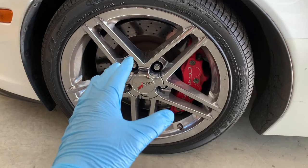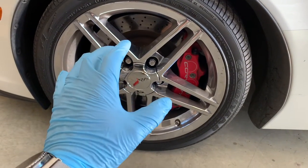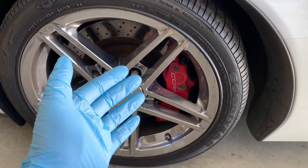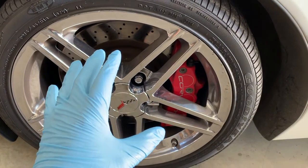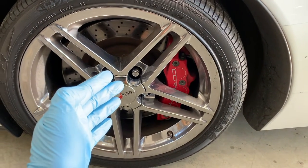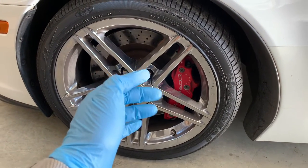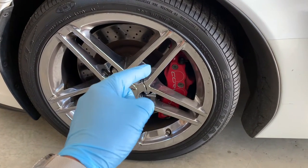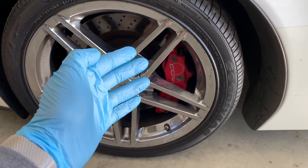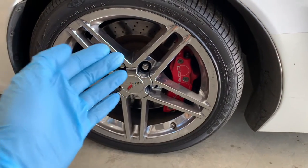Beyond that, the big difference between the categories is as follows. First, there's the boiling point — the higher the DOT number, the higher the boiling point. Remember, the temperature can reach up to around 800 degrees Fahrenheit or 427 degrees Celsius. While it's important to note that these high temperatures are only where the wheels make contact with the brake pads, not the brake fluid itself, some of that heat is being transferred into the fluid, which means that the fluid needs to be stable in order to function.